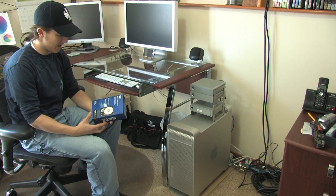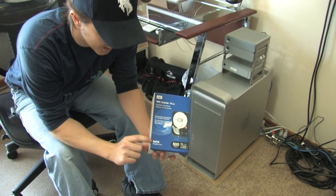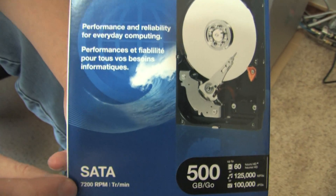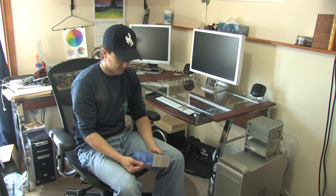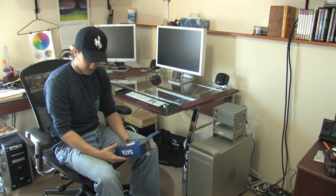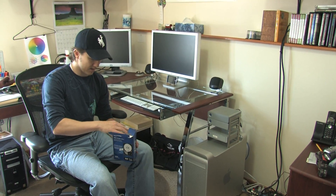I got a 500GB this time, not really because I need the space but just because they're cheap. The one thing that is really important is that it's Serial ATA and it's also 7200 RPM. The RPM is really important — 5400 is generally what's in a laptop and a 5400 drive isn't quite adequate for doing really intensive editing. They also make 10 and 15,000 RPM drives, which are super fast, but as far as reliability, I think you get the best longevity and performance out of a 7200 RPM drive.